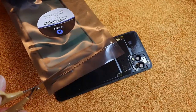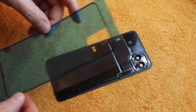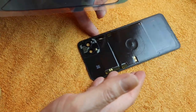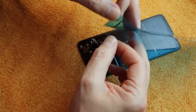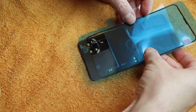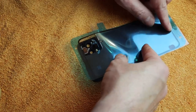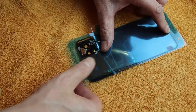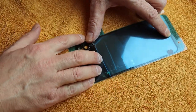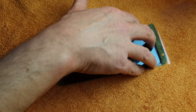I disconnect it again and continue with the back plate of the phone case. The battery exchange package contains a complete new adhesive stripe for it, also covered in several protection layers. I have exactly one attempt to place this stuff correctly, so this requires thoughtful operation. The adhesive is packaged in a way that it should be connected to the back plate first. I remove the first protection film, but only in the upper part. This allows me to position the whole piece as exactly as possible in the lower part without everything gluing together immediately. Once it fits, I finally start connecting it at the top and then slowly and steadily to the bottom. This way, the adhesive is placed correctly and without accident.